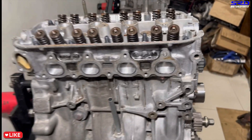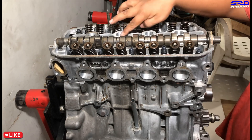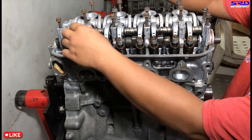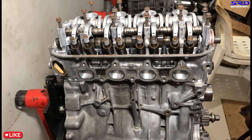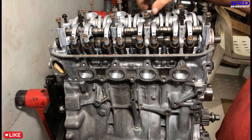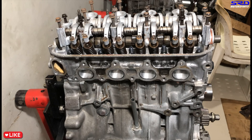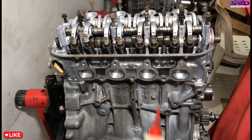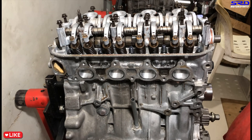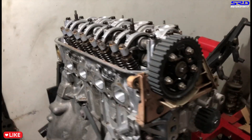My colleague dropped in the cam - time-lapsed so it's not too boring. Now the rocker arms are in. You've got to lubricate all the cam cap bolts to be sure, because locally we always see heads with cam cap bolt threads pulled. It doesn't even take that much torque - you just need to make sure it's well lubricated and the cam caps are aligned well so you don't pull threads.